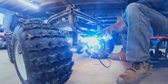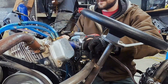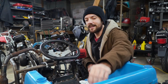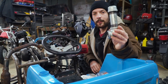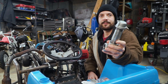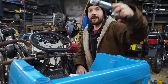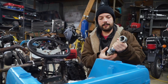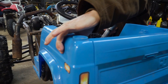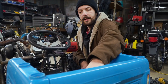We've checked over the chassis and done a lot of welding. I'm working on installing our throttle cable holder. Our pulse pump is all plumbed up — it's all looking really good. The next challenge is installing a fuel neck. We went to our local hardware store and got some galvanized threaded pipe, which we're going to grind the galvanized off before we do any welding. We're basically going to drill a circular hole in our fuel tank. We'll mount it so it pokes out right here, drill a nice hole in our body — it'll help hold the body on — and it should be a pretty sweet semi-factory looking fuel filler.